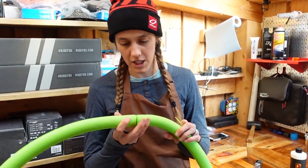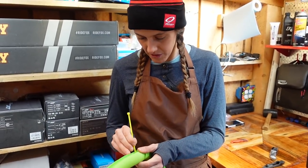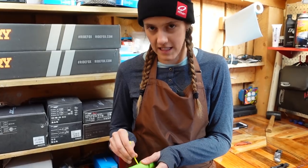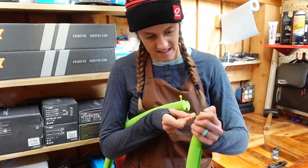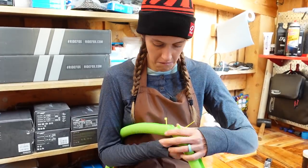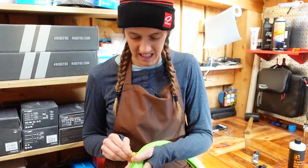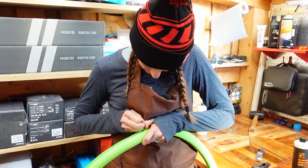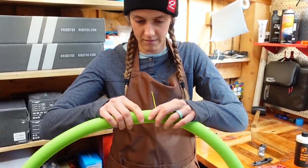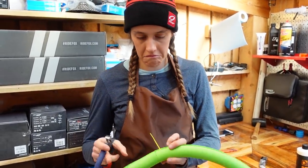We did a video about airliners when they came out years ago and people were like, that's really easy, you could just use a pool noodle. The advantage of something like this or CushCore over a DIY pool noodle insert is it does not absorb your sealant and it doesn't flatten over time. They say it's like a thousand riding hours — more than you're going to get out of your tire. We will swap these between tires when we replace a tire. And they say that if you do get a flat and have to run it on a flat, you still get an hour of riding on it before it wears out.